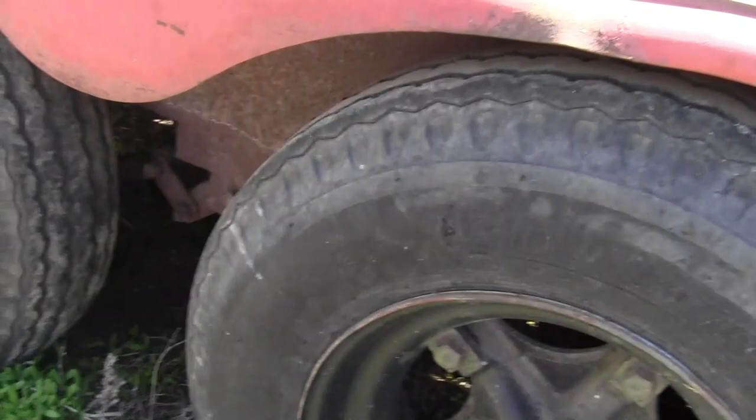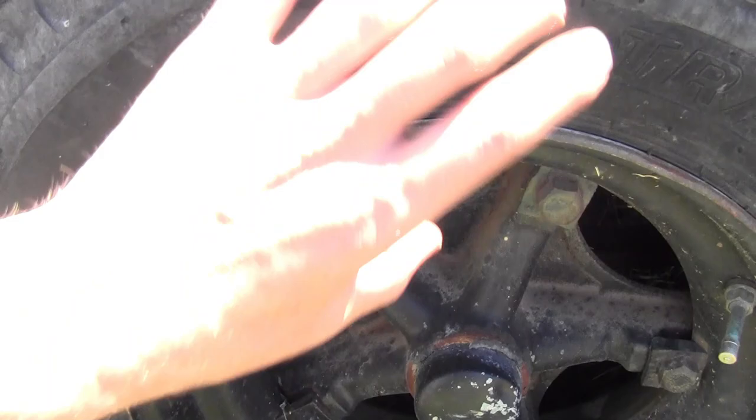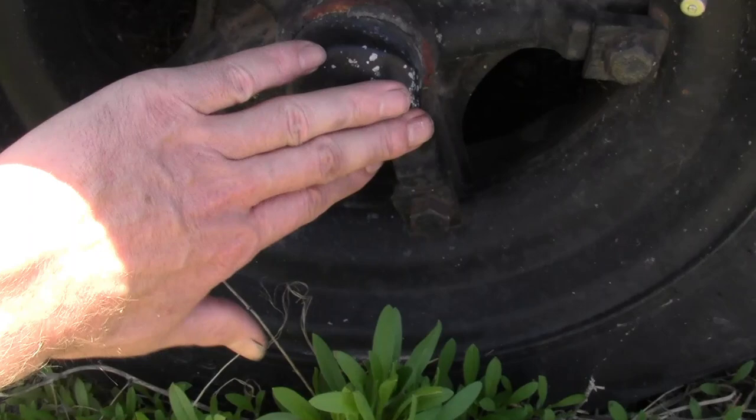Another helpful hint while you're trailering your ride to Sykeston: when you pull into a rest stop, walk around your trailer and reach down to check your tires. Touch the sidewall with the back of your hand — not the front — and check for heat. If it's hot, something's going on. Then touch your hub cover — if it's hot, shut her down. You've got wheel bearings going out and the hub is about to fail. A hot sidewall usually means your air pressure is too low. The heat coming off will cue you to a problem before it becomes a real problem.